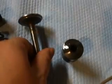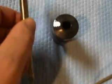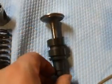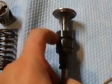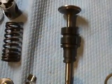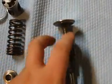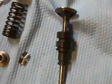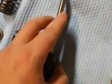and this is an exhaust valve. You have to remember, when an engine gets hot, the metal will expand, and what happens is, if this isn't right, when that goes down in there, it could swell, and two things could happen. One, it will keep sliding up and down properly, but you're going to get a tremendous amount of wear right off the bat, or it could get tight enough that it just sticks open or sticks closed, and you're not going to know what in the world is going on. So you might want to check with a good machinist and have them check everything out.